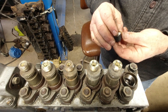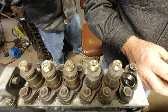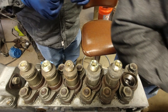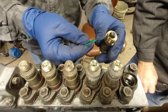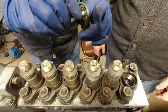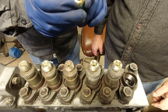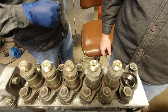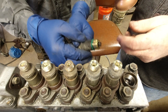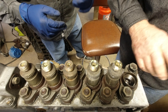Old delivery valve's out. This is just a stock valve — I think the number on it is like 181. I'm going to go ahead and put a new o-ring on this. They come with our kit and it's advisable to put a new one on it. You also want to put a drop of oil on that ring and wipe it around.